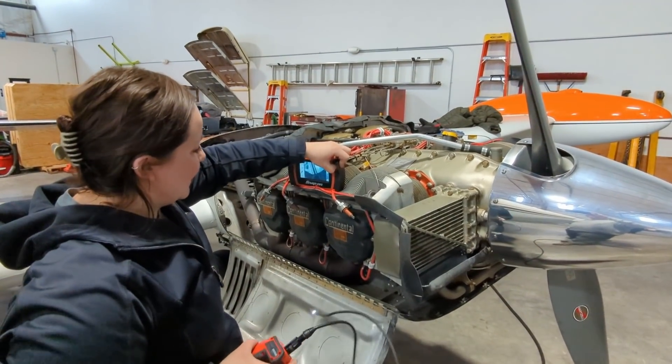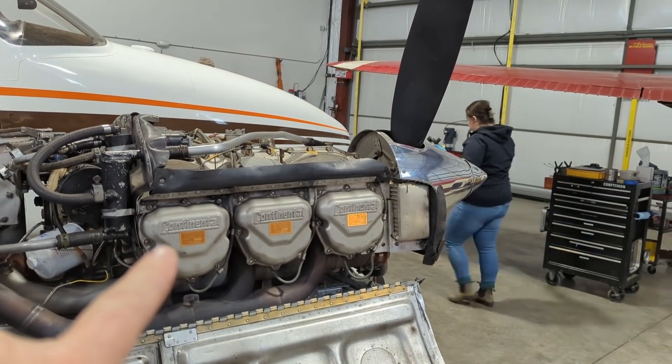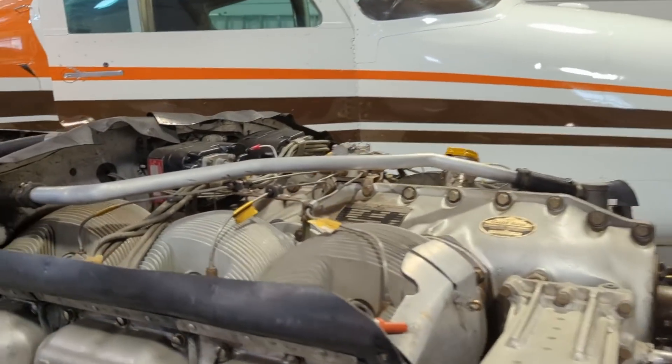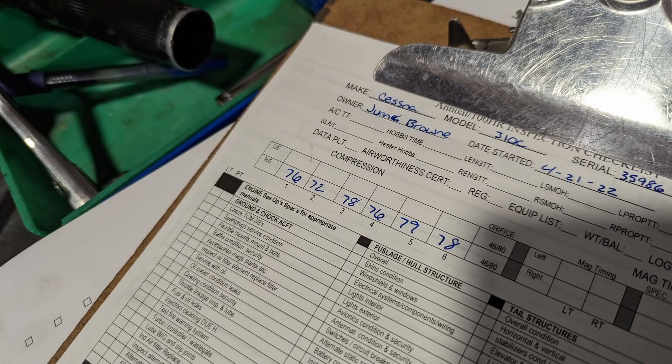No crying today. Jordan had another excellent tip: finish up with the number one cylinder compression up on top dead center, leave the prop there, and now you're all set up for the mag timing check — checking the timing of the magnetos to the engine. Compression check is good on all 12 cylinders. Now we've got to clean all 24 spark plugs — stand by for that scintillating spark plug cleaning action in the next video. Thanks so much for your support of this channel, which helps keep this vintage 1959 Cessna maintained in the manner she's become accustomed to.